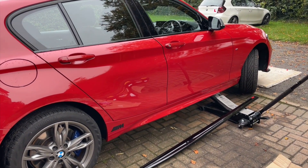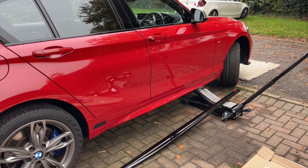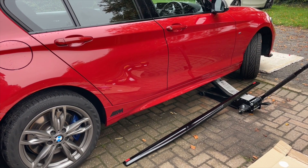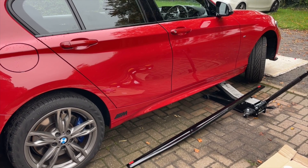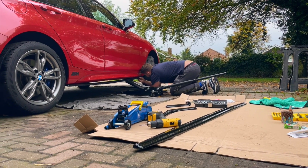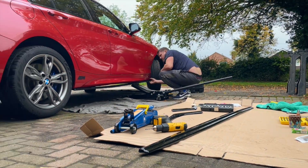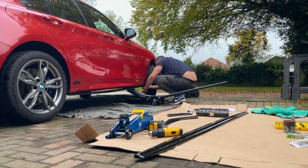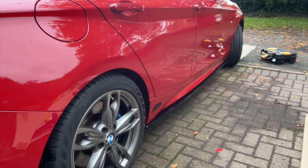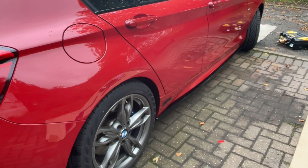I'm not going to reveal the front end just yet - I'm going to move on to the side skirts next. I've just jacked one corner up because that gives me enough clearance front and back. I'm going to use self-tappers on this bit because there's not really any wind resistance or pressure in the build. It's literally just a case of getting the side skirt lined up, put some tape on each end to help since I'm on my own, and then buzz in the self-tappers. I use six at about 300mm distance all the way down. The side skirts are on - pretty easy that one.